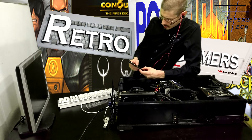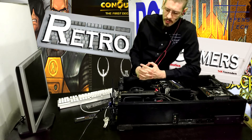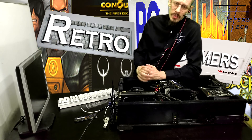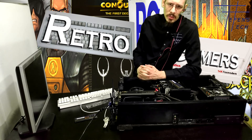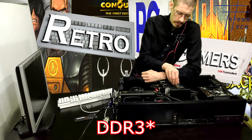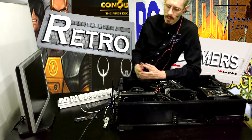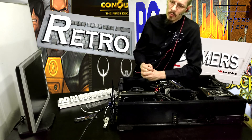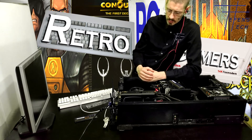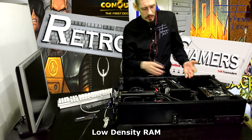If you try to use a high density RAM module in it, it will just not boot and will not work. A lot of people figured out that some LGA-775 boards were actually capable of more than four gigabytes of DDR3, even though many companies advertised a max of four gigs DDR3 or eight gigs DDR2. Some people figured out they were getting eight gigabytes to work with low density RAM. But others spread the word without knowing about density, so when they tried high density modules, it didn't work. The conclusion is: it does work, but you need low density RAM.